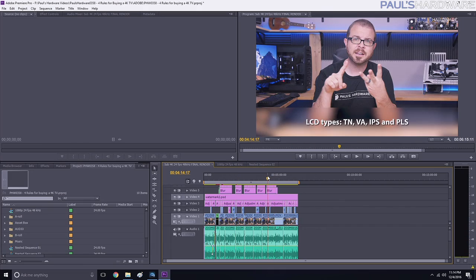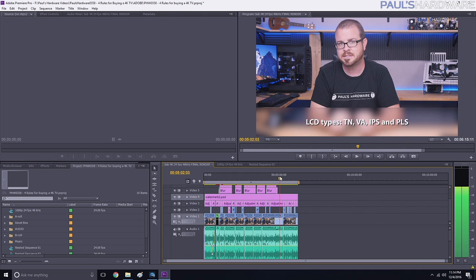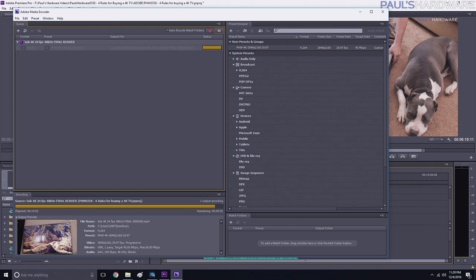And of course the productivity test since I'll be using this for video editing — testing with Adobe Premiere CS6. Timeline scrubbing and playback was pretty good on a 4K project; 4K can get choppy at times depending on resolution playback settings, but I found it adequate compared to the desktops I use. I did a 4K render for a project about 6 minutes and 15 seconds long. The render time at 4K for 45 megabits per second was 15 minutes and 29 seconds — a little more than twice the length of the project — with transitions and overlays involved. Perfectly adequate and what I'd expect from a 6700K at this frequency.